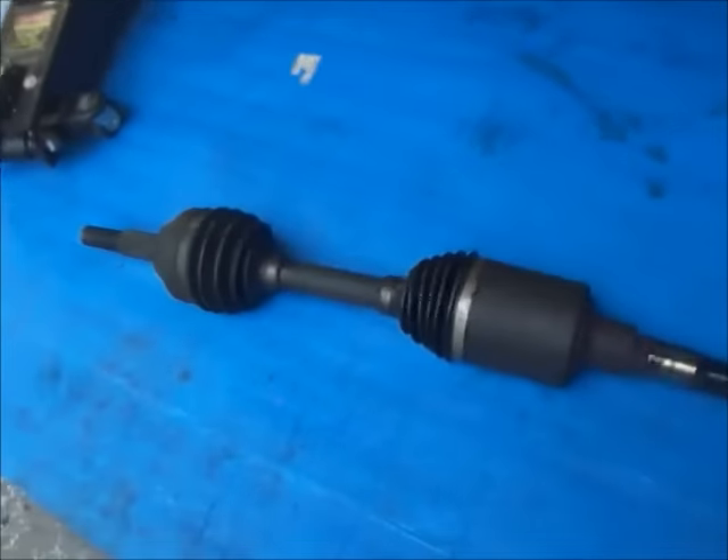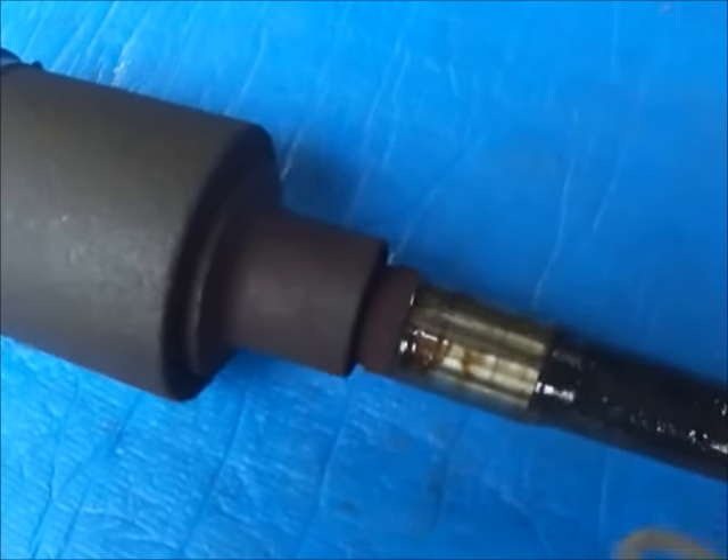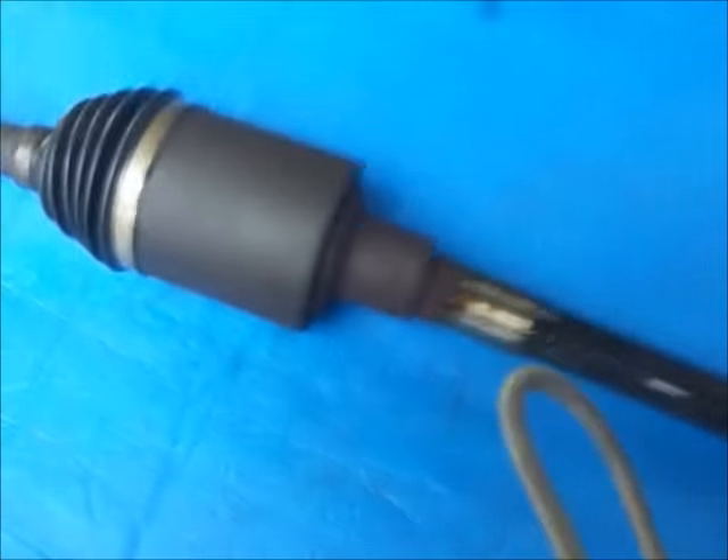I got the shaft out. And that's the problem — it's not even a bearing. That's where it rests, rides on the end of the differential housing, but it's right in there. So that's what needs to be replaced, because in there it seems to be fine. It wasn't even leaking, but yeah, what you've got to go through to get to that — whoa.